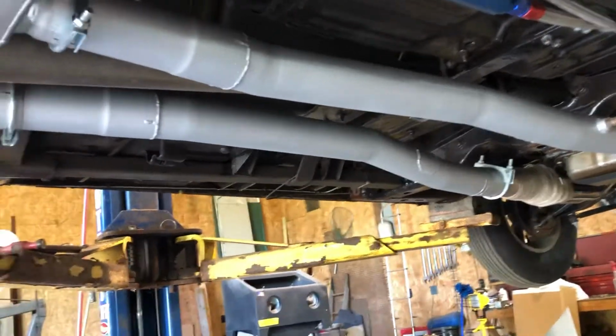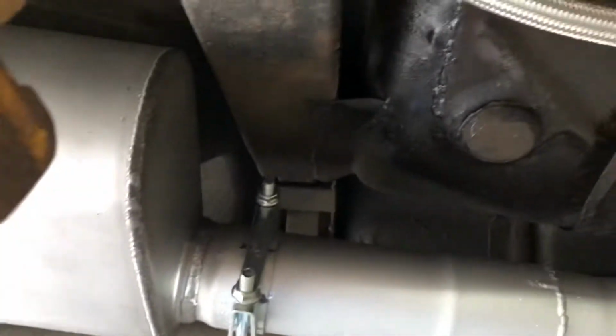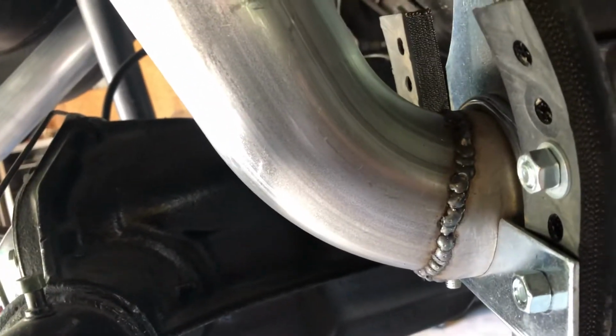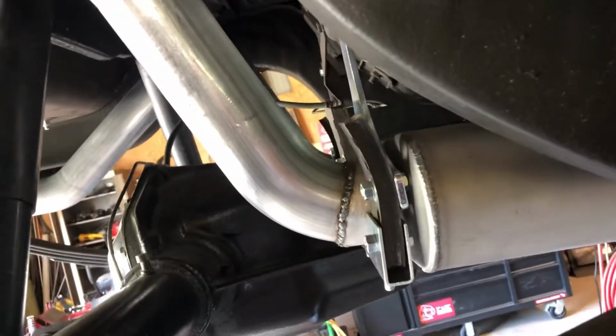TTI pipes in the car because of, you can see it over there, that brace I put in. You can see it right under that exhaust clamp. See if I can get a better shot of it. I've shown this brace in my videos before, but that pushed everything back 4 inches from the regular muffler area. So then I had to compensate for that by coping and cutting, shortening the top of the muffler and the pipe until I could get everything to fit in that 4 inches, and that was a pain in the ass. The inside's done correctly too, so there's no big piece of pipe sticking down or anything to impede the flow. And the tailpipes are in their correct positions.